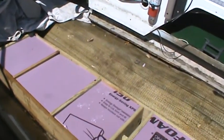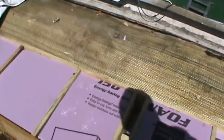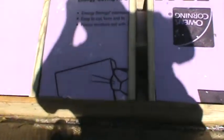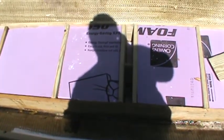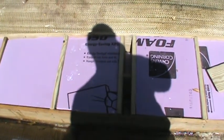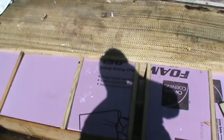I've got all the slats across cut and everything done. You can see right here these two boards cut right here close together — those two slats run all the way across. That's four foot from where it's cut up here. So I've got one piece of plywood that's going to run to right there in the middle where those two pieces are put together, and I did it that way on purpose because I wanted to have some strength where the seams are at. When Glastron put this boat together they just had four slats in here and fiberglass the seams together and called it good.